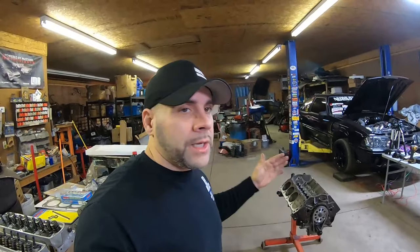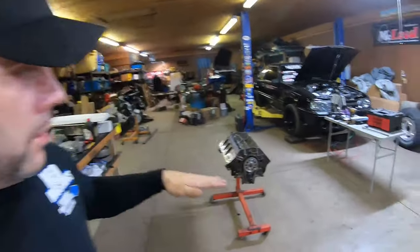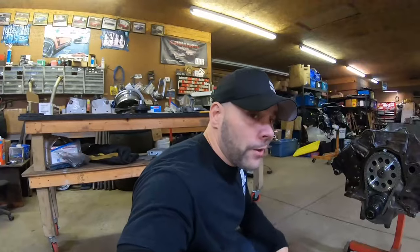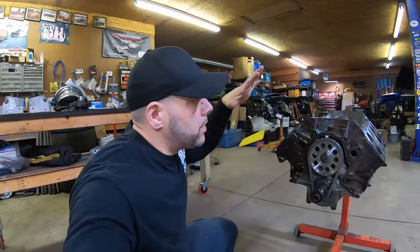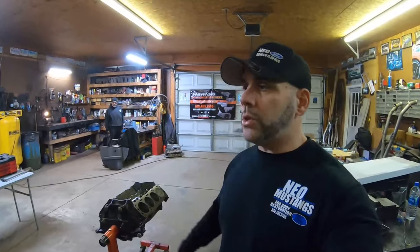This video is gonna lead into the next video, where we're gonna take these cylinder heads back over to the machine shop and we're actually gonna show you here on the channel the piston to valve clearance with this motor. As this motor is pretty much at zero deck, we definitely wanna check that out before we actually try to get it fired up. So without further ado, let's get wrenching back on the block and get this thing buttoned up and ready to go back to the machine shop.